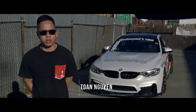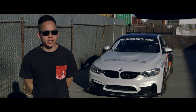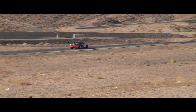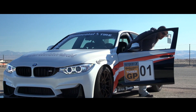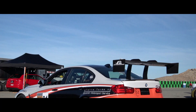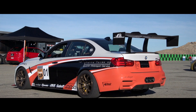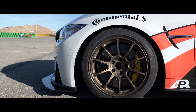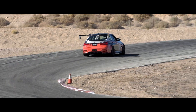It's still fun to be out here with all the other shops, enthusiasts, and a day at the track, a day at the dyno. We always look forward to this event every year. We specialize in a lot of track use and have a lot of race background, so the alignment is aggressive for the track. There isn't a lot of tire wear once it's set up properly — with proper alignment you can have aggressive track alignment without it completely chewing up your tires.